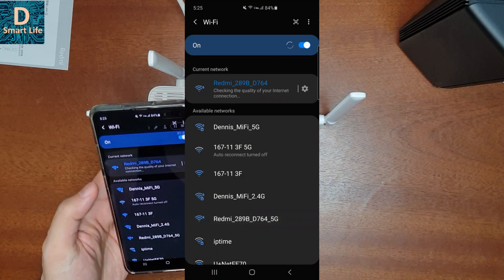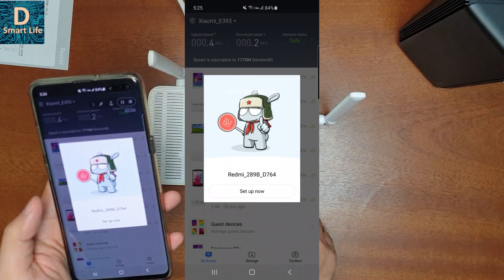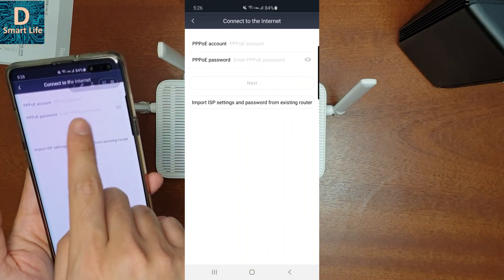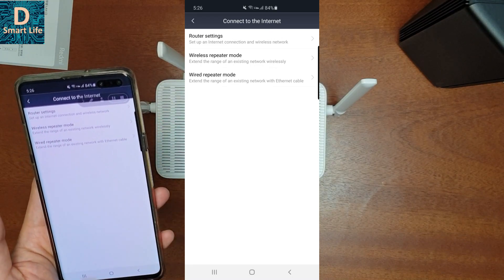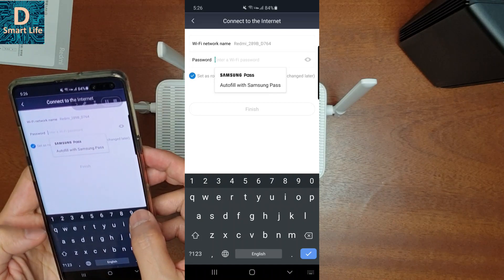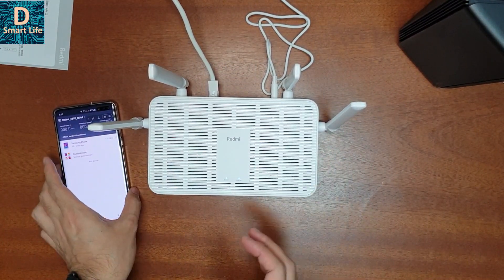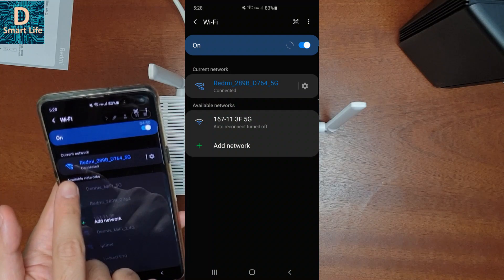Okay, now it is connected. Let's try to set it up — before setting up you have to connect to this Wi-Fi. Let's connect to the 5 GHz Wi-Fi and go to the router setup page. It has now found the router, and it has already detected the internet. There are other options too: if you have a dial-up connection you can enter the account and password. You can also set it up as a wireless repeater, wired repeater mode, and so on. For now let's set it up as a base station. Let's type a password — the setup is complete. The indicator has turned blue, which means the internet is present.